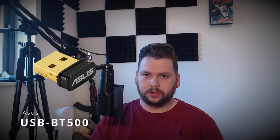I've tried all the troubleshooting: I got the extension cable, removed and redownloaded the drivers, got the latest drivers from the website, swapped ports around from USB 2.0 to 3.0 and vice versa, and tried two extension cables at 3.0 and a 2.0 - swapped them around with no difference. My last resort is to get the ASUS BT500, which people on Reddit say is the way to go. People who had the same issues switched to the ASUS one and all those issues were resolved. I've ordered it and it should arrive Monday.